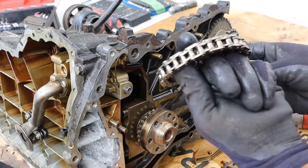The thing I said that looks like a starter near the transmission actually looks like a coolant pump. I'm going to see if I can take this apart. Removing the housing, you've got the inlet and the outlet, and then over here we have the impeller. This impeller is actually driven by an electric motor. So instead of just relying on the mechanical water pump, some circuits of the cooling system rely on this electric water pump.